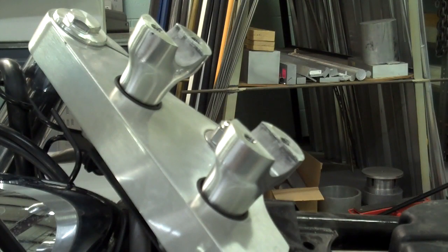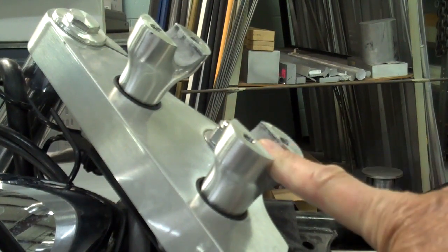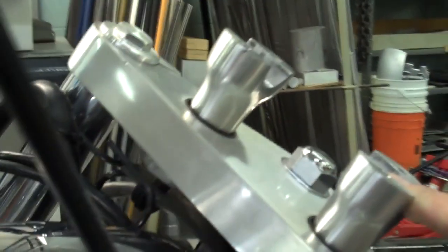Let's go ahead and put our new handlebars on this bad boy. What you do is to remove these risers — we've got to take those off first. There's an anchor nut at the very bottom here. You can see it move when I twist this. I've loosened this ahead of time, so go ahead and just undo those and don't lose the anchor nuts.